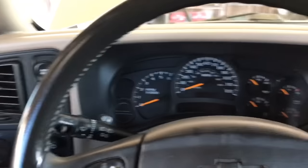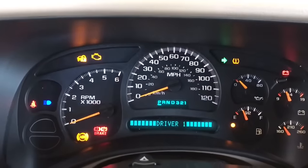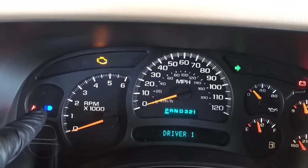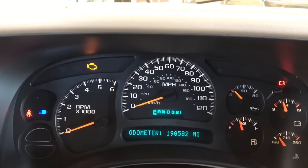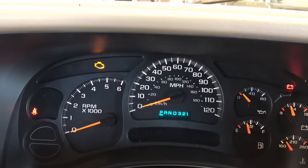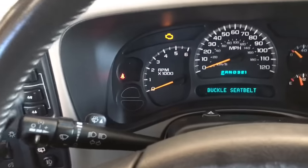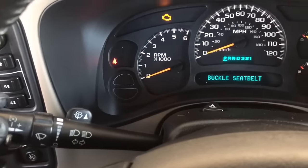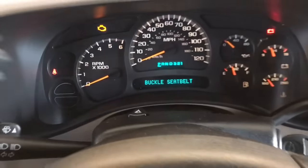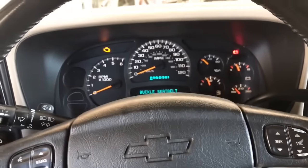With this particular truck, we're having a little bit of an issue with the turn signal. When we go to turn the turn signal on, the brights come on as well, which can definitely be an issue when you're driving. It doesn't happen with the left side but it does happen with the right side. I went ahead and traced it to the multifunction switch, which is the stalk that sticks out right here. We're gonna be taking off the trim pieces underneath and below the steering wheel and removing the connector.